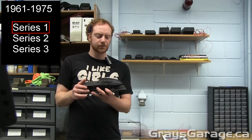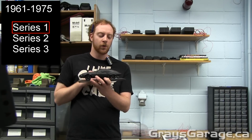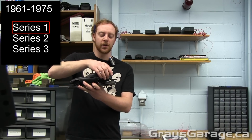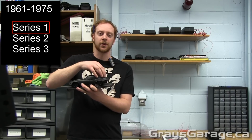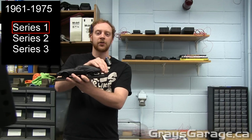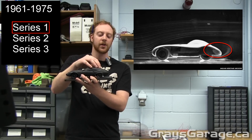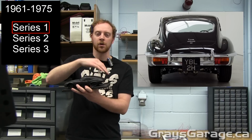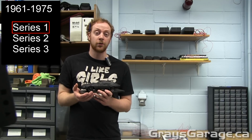One interesting thing, I was talking about the different roof slopes with the 2+2 and the 2-seater. One author noticed, when they took some of the lights out, so there are openings in the body shell, while they were driving, that exhaust fumes were being sucked back into the back seat of the 2+2. That indicates that there's some recirculation back here, just pulling those exhaust fumes from the tailpipes into the back seats. He also noted that the 2+2 gets bluing of the rear bumper, the chrome rear bumper, and that doesn't happen on the 2-seater coupe.